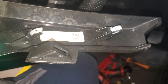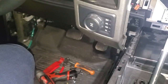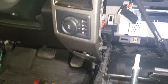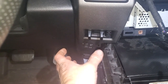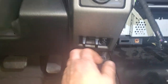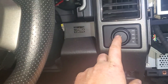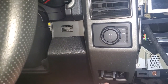These are just quick snaps. Slide your bottom in first, kind of get the bottom set up and in there, and then pull your top through after you get your connectors and stuff plugged back into your four-wheel drive switch. I kind of tilted this up on an angle, slid it in there, and then while lining up the holes I popped it in and then popped the top in. That's because I plugged the connector first before I did that maneuver where I slid it up on an angle and popped the bottom and then the top.